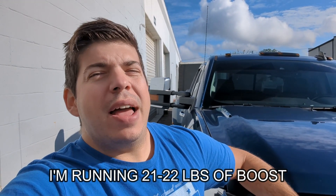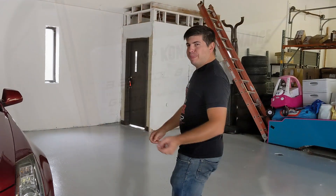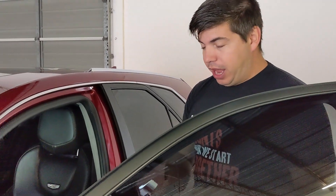The solution is basically a bigger camshaft. I have a pretty small camshaft in this thing — a 229/244 — and for a 427 cubic inch engine, that's pretty tiny. I ordered one up, but then things changed a little because Mike had a baby. So we're going to try lowering the boost a little bit as a test before we go into the camshaft. Mike having a baby means he's off, and that means I might not be able to sneak the bigger camshaft in before the Holden Showdown November 7th. So I'm going to try lowering the boost, see if I can carry the power out a bit higher, and then maybe go into a bigger camshaft for the Cadillac Attack event down in Orlando Speedway, January 28th–29th.